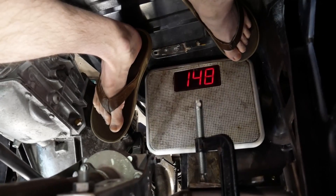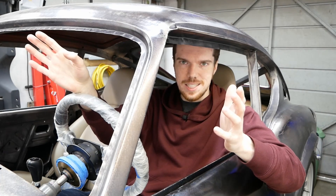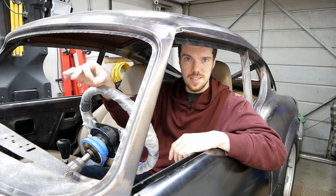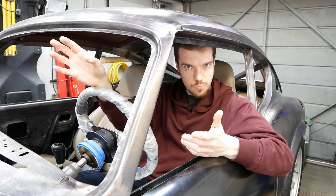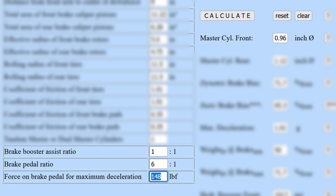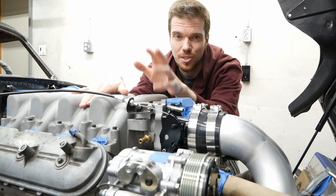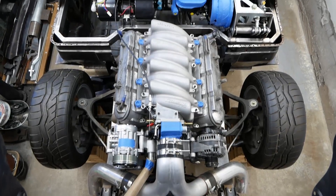Could have done 400, but didn't want to break the scale. Technically, if we leave out the booster or it has a failure, we can still achieve the maximum deceleration possible for our car by exerting 148 pounds of leg force — which we just demonstrated. So that's great to know for emergencies. However, even in lighter applications, there's no way we're going to leg press the car to a stop at every traffic light. We've got a healthy dose of power in this thing, and to make sure it's usable, I need all the driver controls to be equally balanced. So with power steering and a touchy throttle, power brakes are just a necessity.